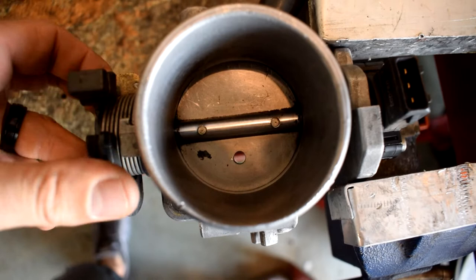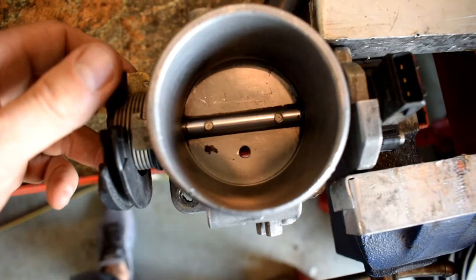So that's a problem, because then mid corner you're always going to have this push, especially on a front wheel drive. So you can't have that, especially on a front wheel drive car, because you really have to be patient with the accelerator, and you can't have it mid throttle, I guess is the term I'm looking for. But I'm gonna try sort that out.